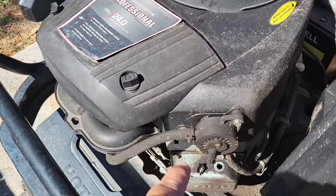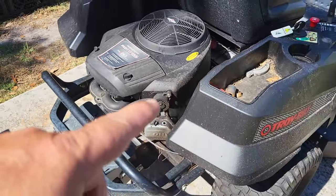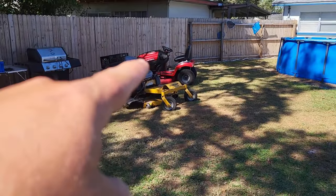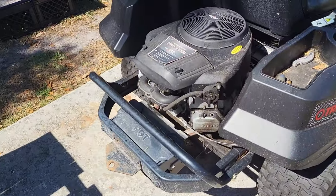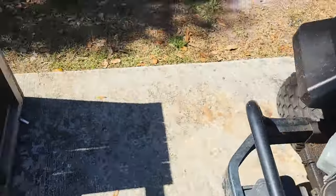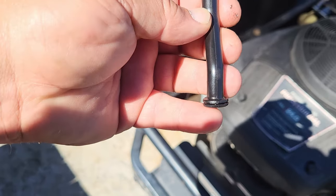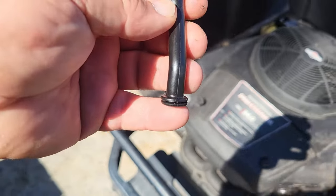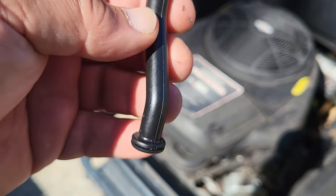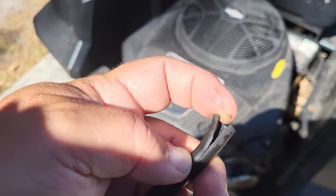The fuel pumps all look the same — it's this hockey puck looking thing and it always has three hose ends coming off of it. They might be in slightly different positions depending on your model, but it's always the same whether it's any other brand, whether it's a riding mower. If it has a fuel pump, the fuel pump has to be actuated by a pulse that comes from your valve cover and goes through a short hose. This hose has a double lip — the bottom portion goes inside of the valve cover and the top portion seals around the top. The valve cover goes in between that little split there at the bottom.